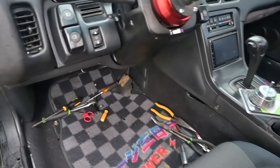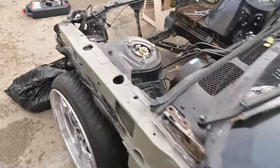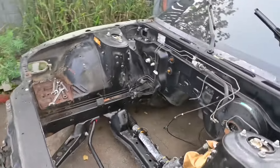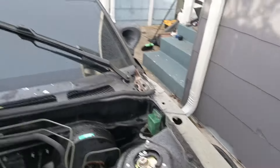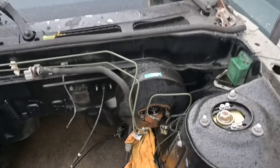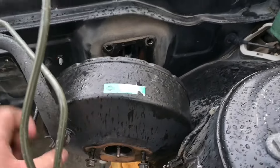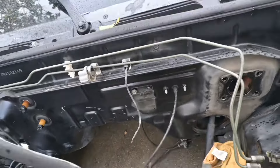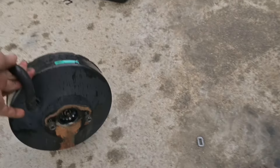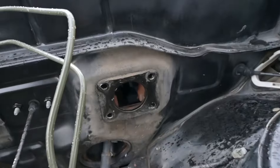Two hours later. Alright guys, so I got all the bolts out and the pin that was holding the brake booster - took me like a good hour and probably made me lose a few fingers. But everything should be loose now, so the booster should just pop out of place. What a pain in the ass. But I needed to get this out - just got to disconnect it from here. It's rusty. Now I'm gonna be able to get fresh paint all up in there.